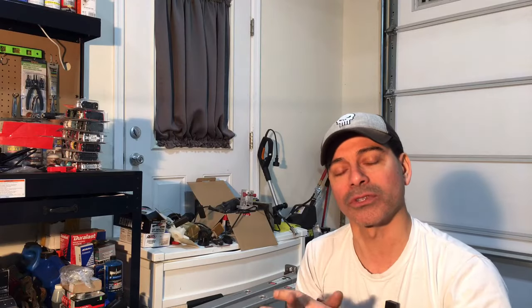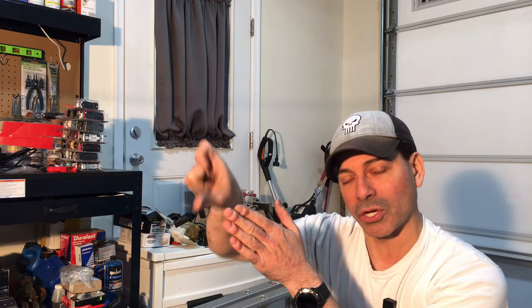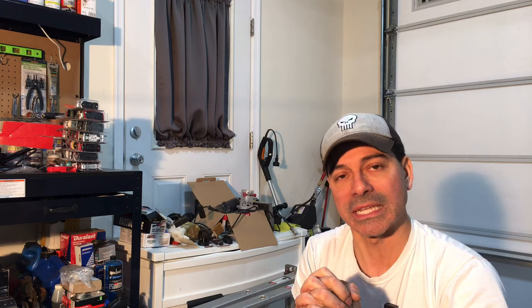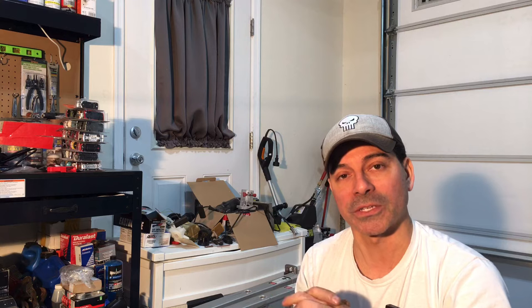This particular vehicle, since this was a custom built vehicle, I think because of the way that the frame is, it has a very tight frame coming across there, so they had to cut that fuel filler neck short to make it curve enough, and that's why we have that breakdown there. But this would even be if you had a regular fuel filler neck itself that's leaking, or any part of that fuel filler hose, you could use this same process. So let's go ahead. I'm going to cut the desired amount off, and then we're going to start rebuilding it.